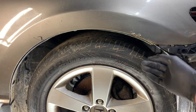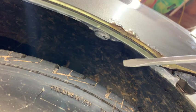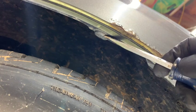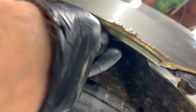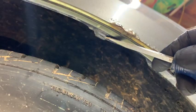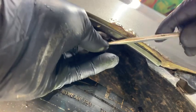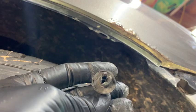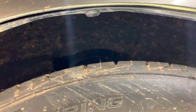Next, come around to the side of the fender where the fender liner meets the fender. Underneath here are plastic clips that hold the fender liner onto the fender — typically four of these style clips. Use a flathead screwdriver, pry on one side, wiggle it back and forth, then spin the clip around to the other side and work it out. Going back and forth slowly will help you get these out without breaking them.